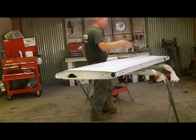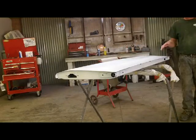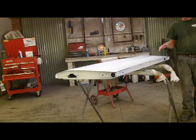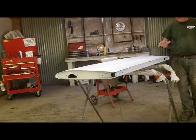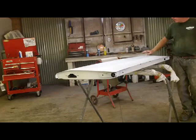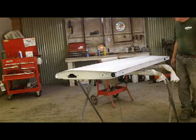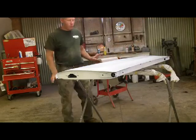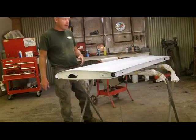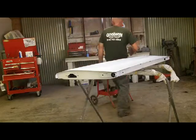So that I don't blow a bunch of primer underneath it and then have to sand that, because I've already prepped the back of the tailgate. So all I have to do is block the primer out in those spots that I'm doing and take a scuff pad and blend it around the edges and then go over the tailgate one last time with probably some scuff soap and a scrubby pad. I didn't want to get it wet today, so I scuffed it dry and I didn't want any moisture over those filler areas.